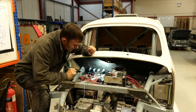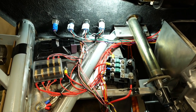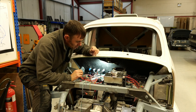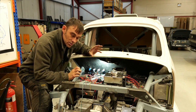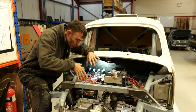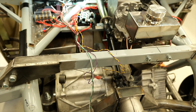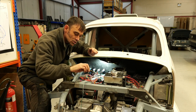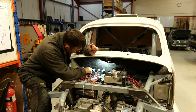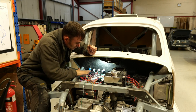Next on to the wiring. I've been busy in the evenings and weekends starting to do all the low voltage wiring in the car. It's looking like a multi-coloured plate of spaghetti at the moment but that's how it always starts - it's a rough route for the cables, and then once everything is confirmed to be working, we'll wrap it all up so it looks a lot tidier. These wires are going to be for instrumentation in the dashboard - you've got one of the displays here, CAN communication going to the dials, some switches on the dashboard: reverse, neutral, forward, parking brake. And 12 volt fuses here.